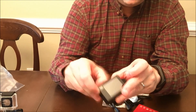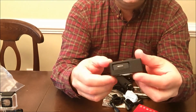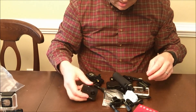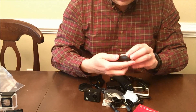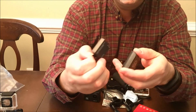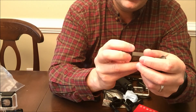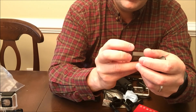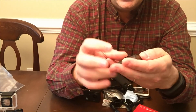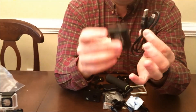Down here on the bottom, you pop the battery in. It comes with two batteries — it's got a nice little tab so it's really easy to pull in and pull out. It comes with two batteries and a charger. This is a PG 1050 milliamp-hour lithium battery — 3.7 volt, 1050 milliamp-hour, 3.885 watt-hour rechargeable lithium-ion battery pack. The fact that they give you two of these is really nice because then you're not stuck on the go. You get a little micro USB charger — very simple.